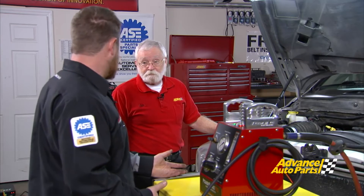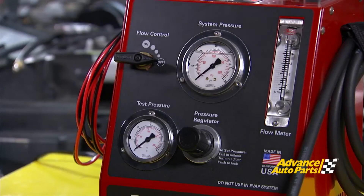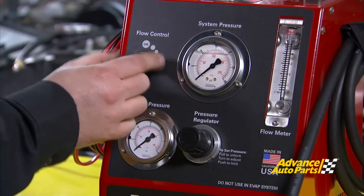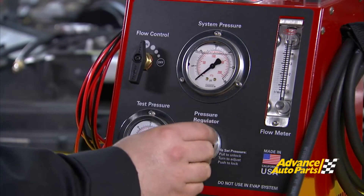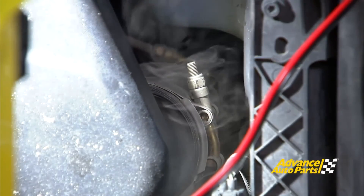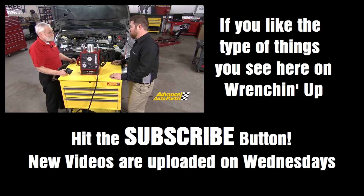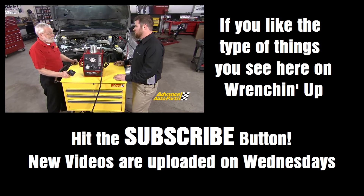What's going to be different about this test? Normally with your smoke test and your standard machine, the only thing you can control is flow. With this machine, we can also control the pressure. So what we want to do is turn on our flow control knob and slowly start increasing our pressure to a modest level until we start to see a leak. The only way you're going to find a leak on a forced induction engine like this is with a high pressure test machine.